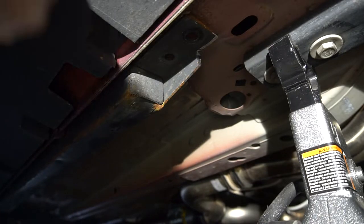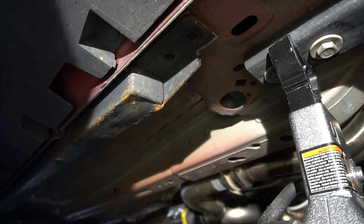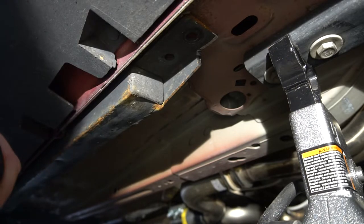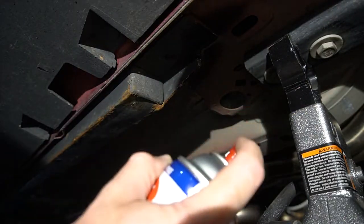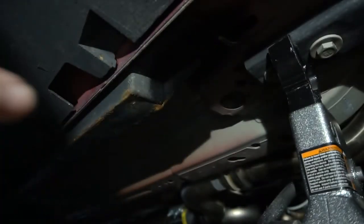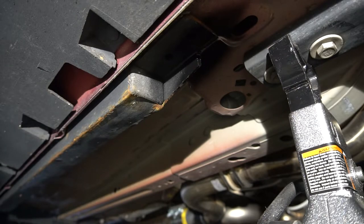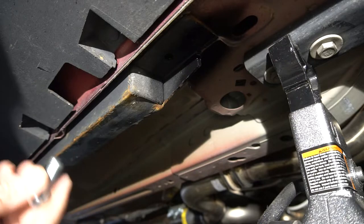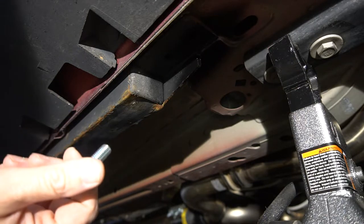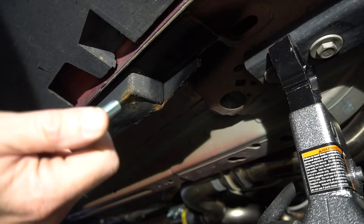I didn't want to cut the tie-down bracket because that is something that needs to stay like it is — in the shape that it is with as much material on there. So I didn't want to sacrifice that part, but we can sacrifice this part of the rail because it's not under a lot of tension. Let me shoot a little bit of paint on there — as you can see they're kind of rusting up anyway. Just going to shoot a little bit of black paint in that area to keep it from rusting any further. It dries pretty quick so we'll give that just a second while we put some Loctite on these bolts. The bolts are long enough — they will go up through the bracket and the jacking rail no problem, plenty long enough.